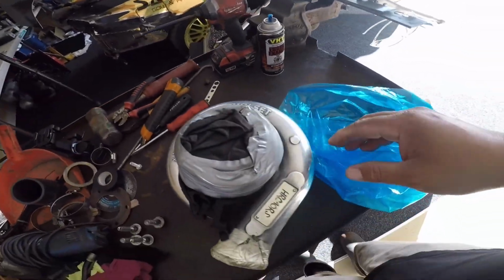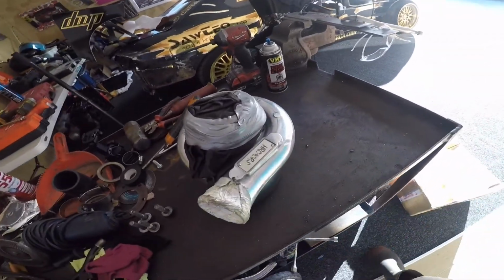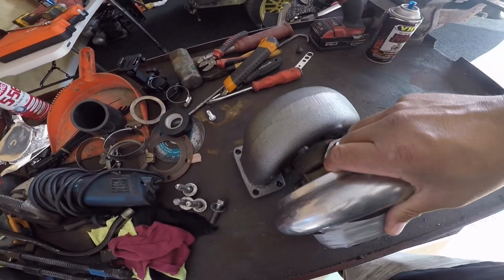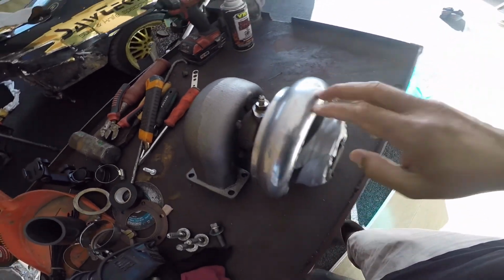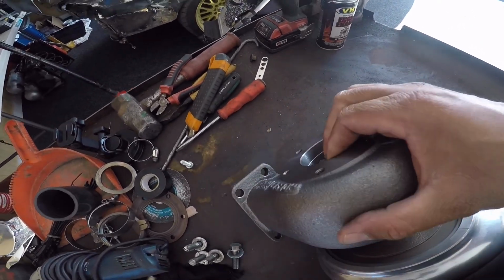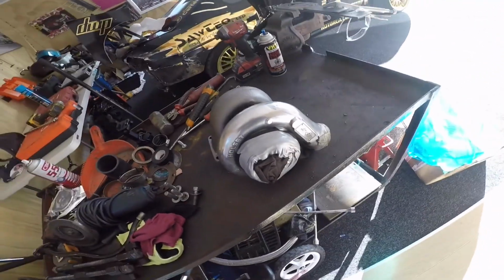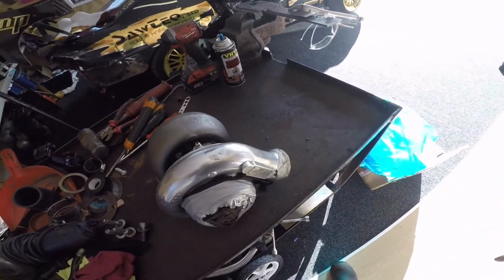We had issues on high boost. We actually had a couple of shims sort of kick out from under the buckets, and we put it down to the exhaust housing being too small, building up back pressure. That's what a few people actually said. So Steve Murchie, he's done our turbo for us, an HX40, which we've always run since we went to the RB30. And then Brian from NDT sussed out the exhaust housing from Steve and put it on for me. Good cunt, thank you. And yeah, I'll just put on the oil return and stuff, and then I'll slam this girl back in.